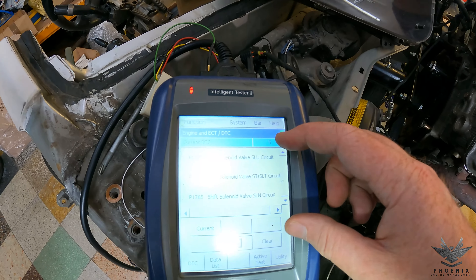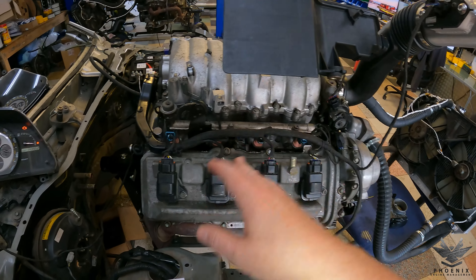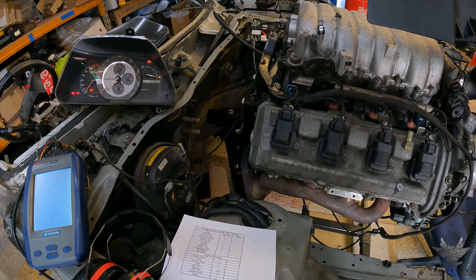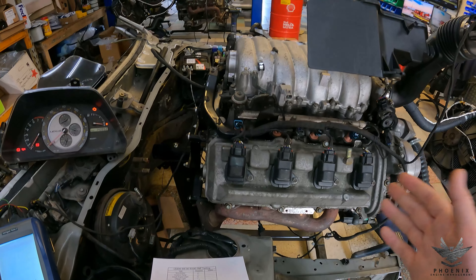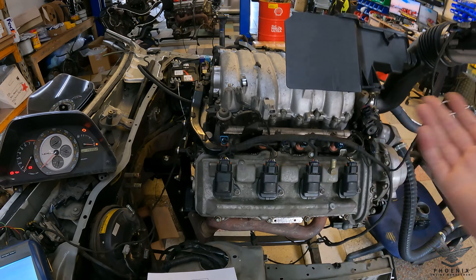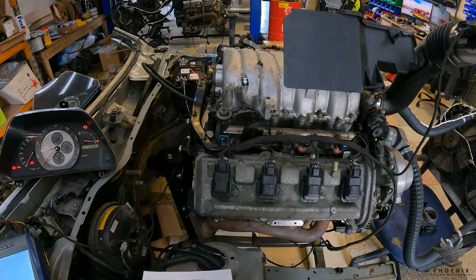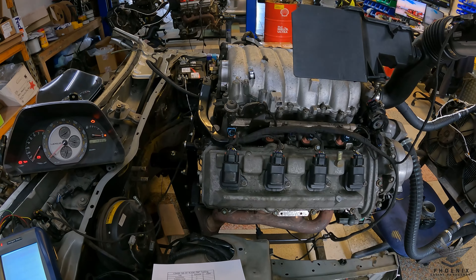As you can see — five codes, and that is all you should have. Anything else, like anything for the mass airflow sensor, the throttle, a misfire, or a coolant temp sensor, means a genuine problem and will cause the check engine light to come on, which you can then rectify. Sorry it's a really short video. Obviously we built this harness many years ago, so I don't have build photos. We've literally just changed the patch harness around. But this also demonstrates that if you have a harness built for an Altezza and you want to put an IS200 in, you can just send the harness and we can adapt it for you. Thanks for watching guys, thanks for watching Hando — we'll see you again soon. Bye bye.